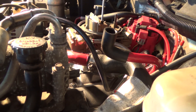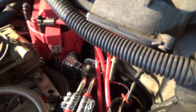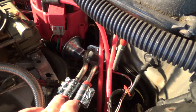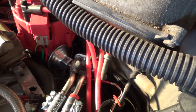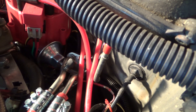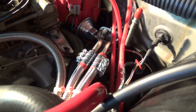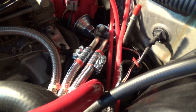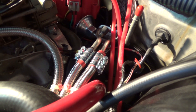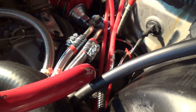I wanted to point out a couple of things about the fuel lines. You can see my fuel lines come up from the back — this one here is the high-pressure line, this one is the return line. I couldn't make the AN fittings work on the bottom side where it bolts on, and these lines originally came up and over into the middle of the other intake. So I merely cut them back, cleaned them up real well, slid my braided lines on there, and I've got three clamps on each one — so far that seems to be doing the job.